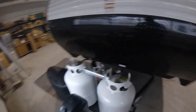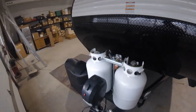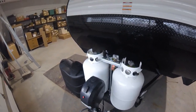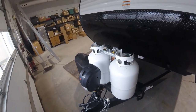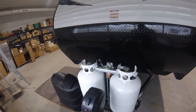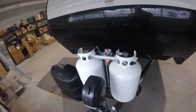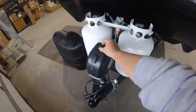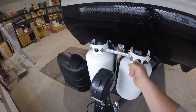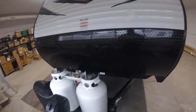On the front of the trailer, this one has an electric tongue jack. The controls have one button for the light and up and down. This jack also has a crank handle in case it fails. To use the crank handle, just pop the rubber plug out of the top — the crank handle is inside the trailer. Put it in and crank it to get it on or off your vehicle.